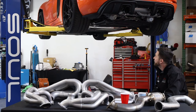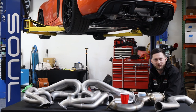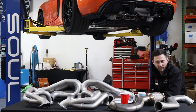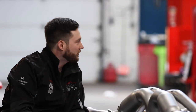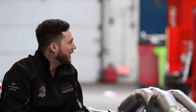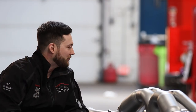For guys that just really don't care about full three-inch volume and want to reuse their titanium Weistec tips — we hear you. We will neck down our race exhaust and valve exhaust system to two and a quarter to fit your Weistec tips; that will be an option. Just know going in that you are creating a speed bump on flow and that will affect it. We of course have different exhaust tip options ourselves.